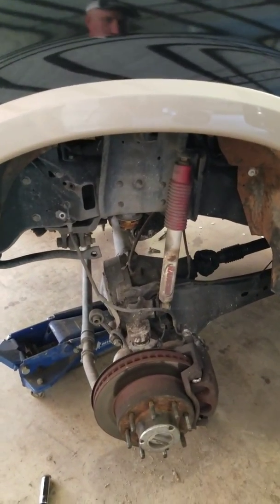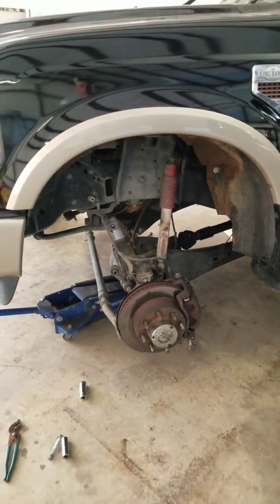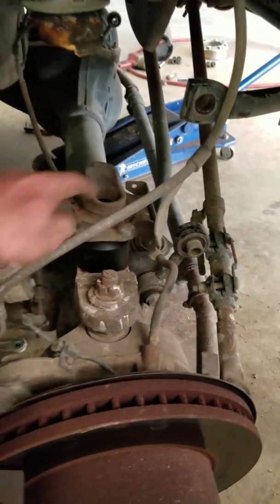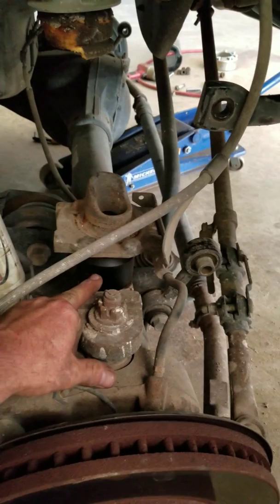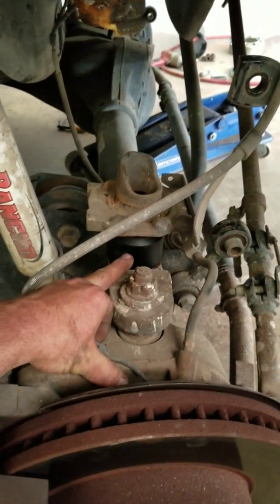Removal of the bolts, the front wheels and tires with the air compressor and the right tools takes about 20 minutes. So our next step was coming in, remove the spring perch — there's a bolt in the center of it. You'll remove that, discard it, and install the new 2-inch spring spacer supplied by the MotoFab kit.